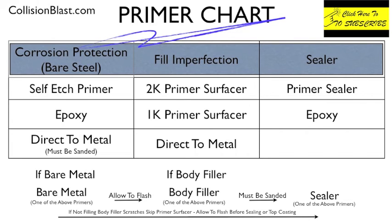It's going to take a lot of coats to finally get that to completely hide that gray spot. Well, if we use a sealer that's about the same shade, that's darker, it'll help hide that. So you put that sealer on that gray spot, and now we only have to use a couple of coats of paint. So that's what primer sealer is for. It's for hiding what's underneath.